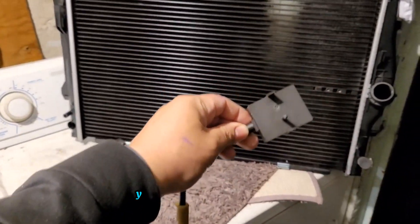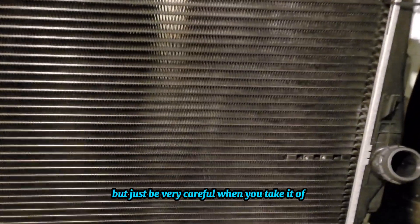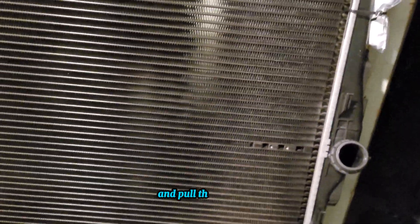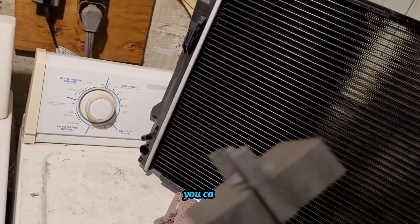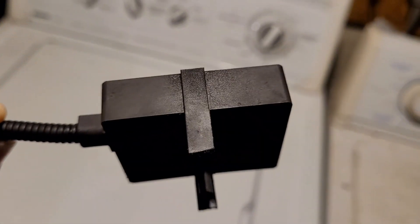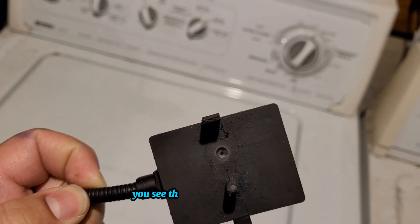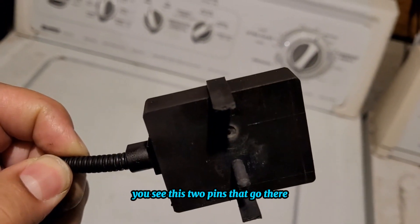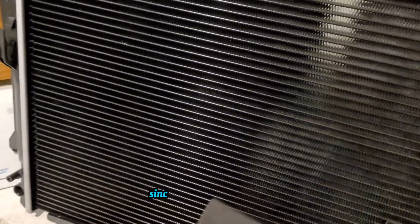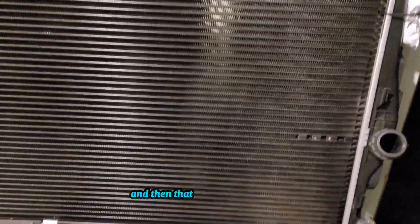When you have your old radiator, you can simply take the sensor off — just be very careful. The sensor sits right here, so you want to pry from the side very carefully and pull it out. As you can see here, the clips actually snapped, which is going to happen. In the center there are two pins — one is still there and the other broke. Since the center is still good, I'm going to reuse it and place it in the new radiator.